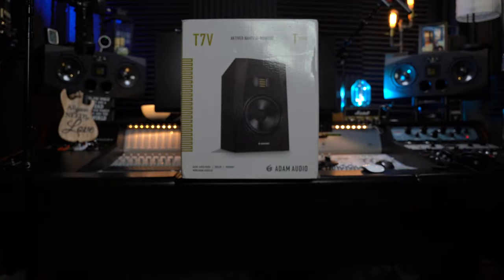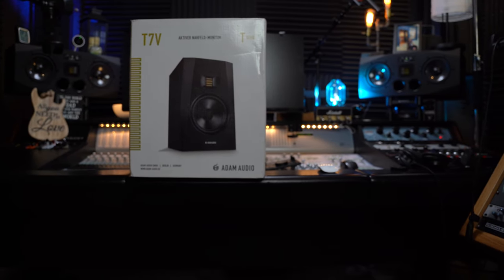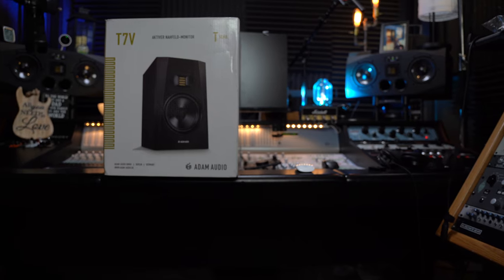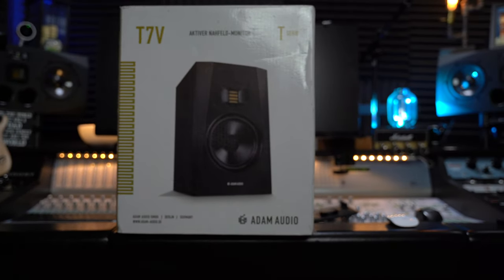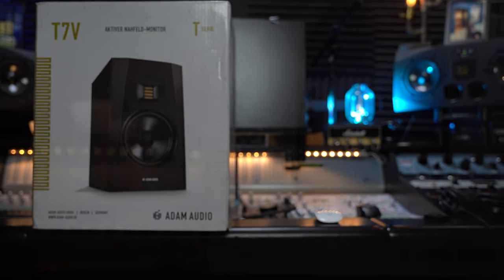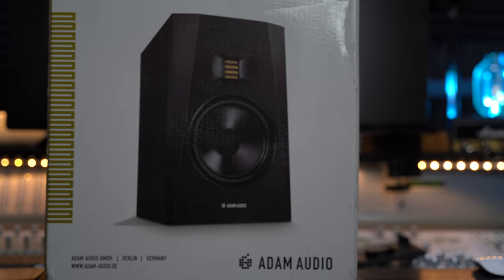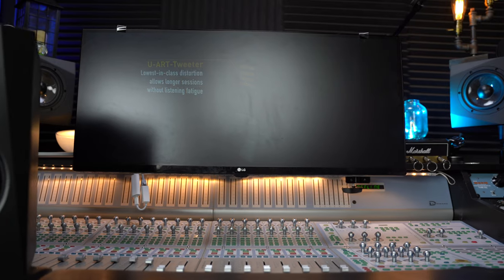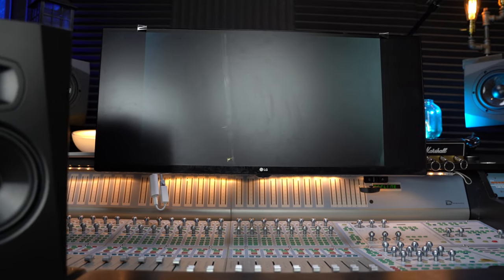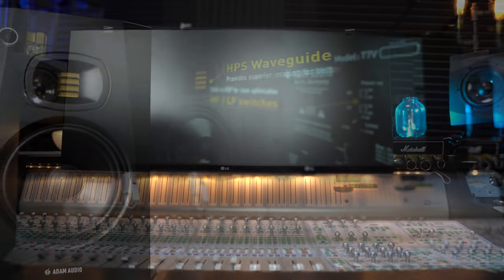This series comes in three different models: the first with a 5-inch woofer, the second with a 7-inch woofer, and the last with an 8-inch woofer. The tweeter in all three units is powered by a 20-watt power amp and the woofer by a 50-watt power amp. Each monitor has its own level control. There are two three-way switches that adjust the high and low frequency response by plus or minus 2 dB, and all three models can automatically accept AC voltages ranging from 100 to 240 volts.